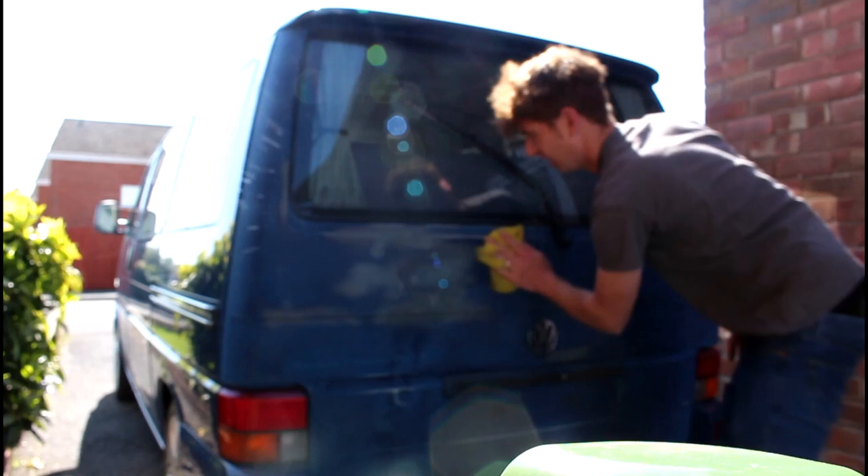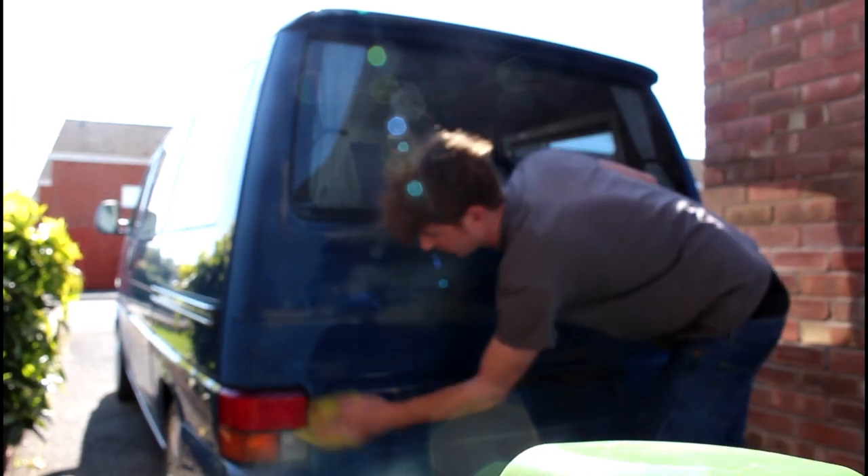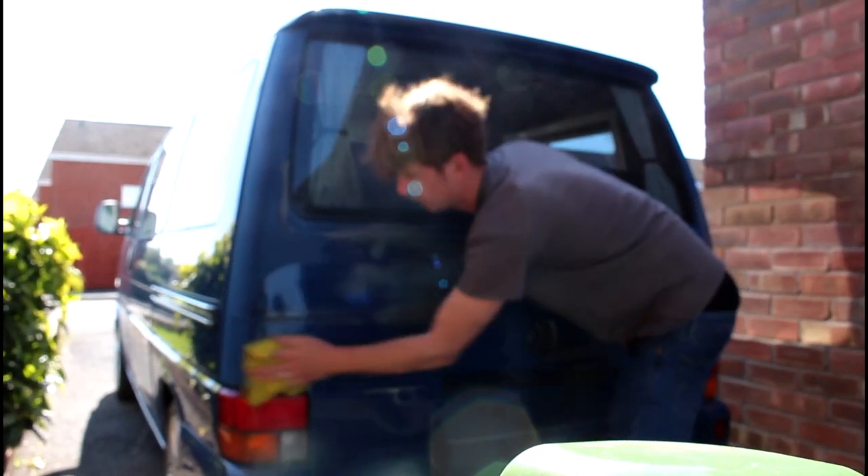So this is where we've got the spoiler repair - we've stuck it back in and sanded it down. Then we can wash all of this dust off the back so we can start having a look at what we've got to fill up. Nothing special, just a bit of fairy liquid to try and cut through any grease on there.